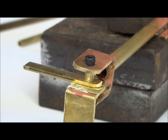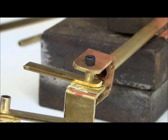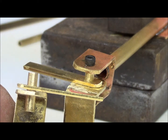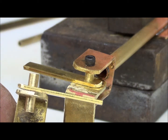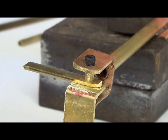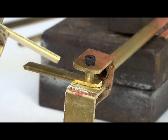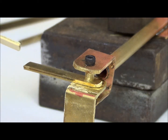Alright, now I'm getting ready to set up my actual steering of my runner. You can see what I have here. I'm using that short piece of tubing. Got everything up pretty much in the center. Doesn't have to be exactly exact, but as close as you can get it. And use your little triangle to try and get this set up as a 90, coming off of the main piece. This little piece here is what your tie rod ends are going to connect to.